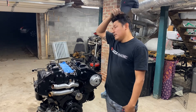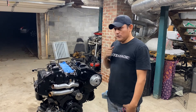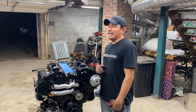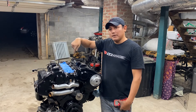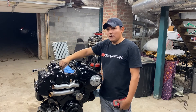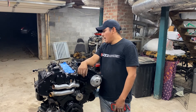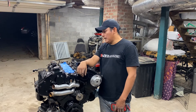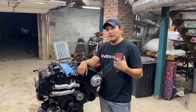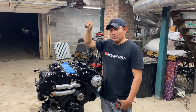You can still remove the injectors without taking the manifold off — I've done it once already, but I didn't really like it. Because you have to dremel the side of the intake manifold so you can fit a flathead screwdriver to the bolt caps. You can do it, but on my case I prefer to remove the intake manifold so I don't have to dremel it.